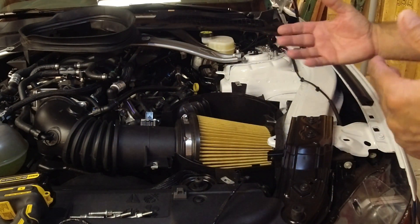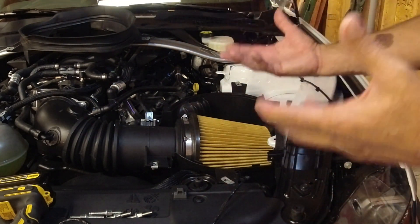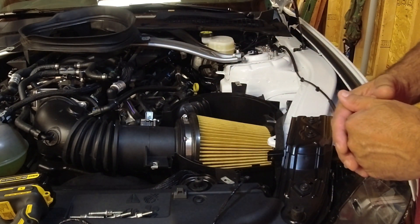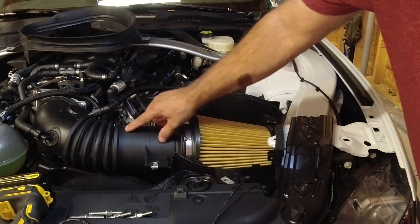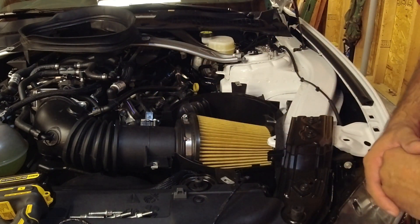That should correct your air-fuel trim and you should be okay. The restriction is removed because the trap is out. From what I can tell, the diameter on a 2021 is the same as what it would be on a 2022 with the tube inserted, so they made this section of the 2022 wider to allow for that hydrocarbon trap to be inserted.